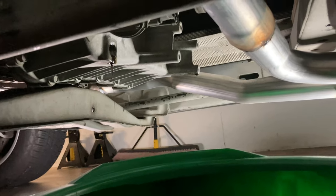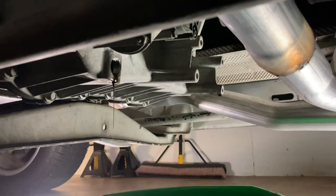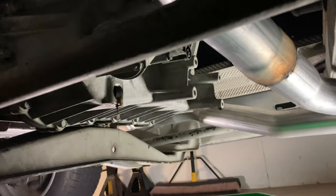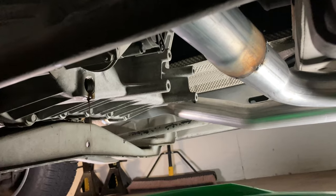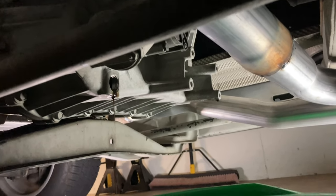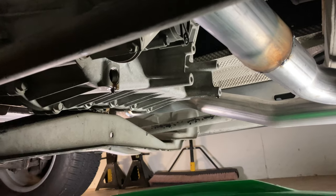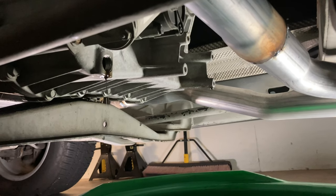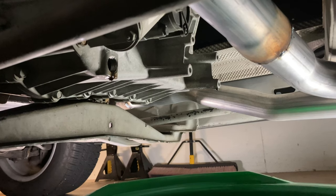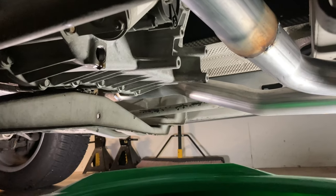I'll button this up and I'm good to go for the oil change. We've moved on to the transfer case — I don't think I'll get to the differentials today, but I'm very glad I did this. The fluid was black; I don't know when it was last changed, no record of it. The drain bolts and fill bolts are both 3/8 ratchet — no socket, you just stick the ratchet straight in. Always try to undo the fill bolt first before the drain bolt, which I did, no problem. It's basically just fill until it starts seeping — when I undid the fill bolt a tiny bit was dripping out, so it was full.